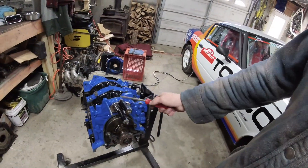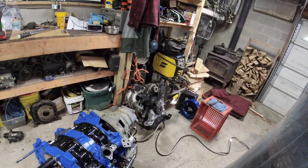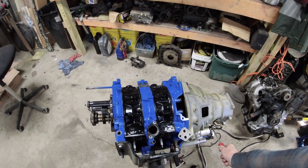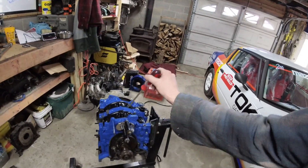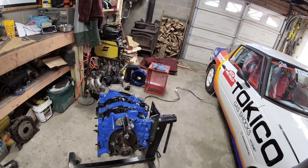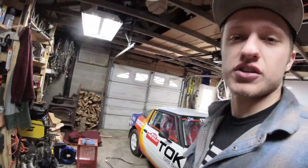Movie magic — the next day. We've got a coolant pressure tester on here, front stacks in place, bell housing and stuff's on. I hit the button and this thing sounds good now — that's how it should sound when you're cranking it. So we know nothing's jacked up. I'm going to put the compression tester on it, put 20 psi pressure in the coolant system, and see if it bleeds down, and then also check what the compression numbers are.